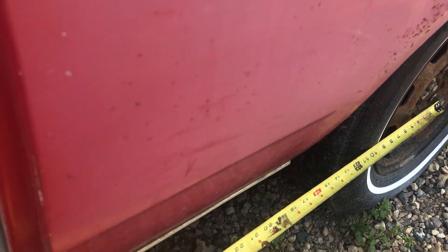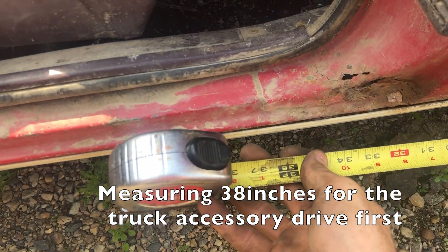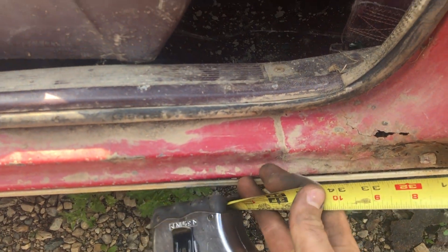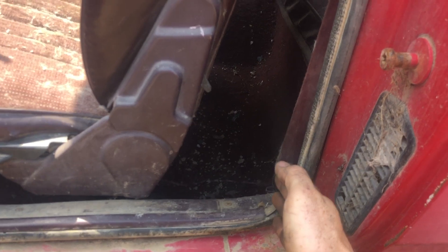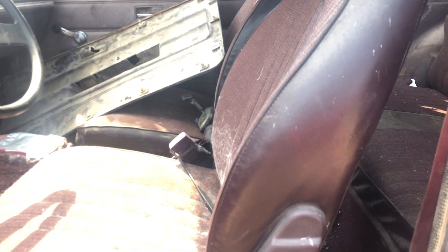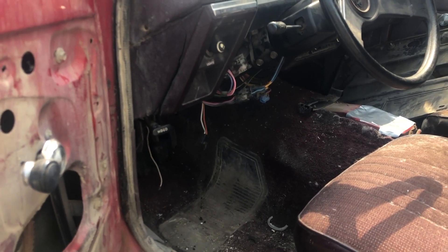Right about there is the center of the axle, and we're a little bit further than what I would like. Definitely LS4. If we go with the LS4 stuff, that's four inches — it's going to be close, and I'm still going to have to have the firewall built out a little bit. Honestly, that might work better: if you've seen the LS4 water pump, the outlets are all coming down off the side, so those hoses will be ready to go forward and under the floor. We can angle it too — the seat will stay in the same spot and we'll be able to add more legroom in the front because there's no motor there.